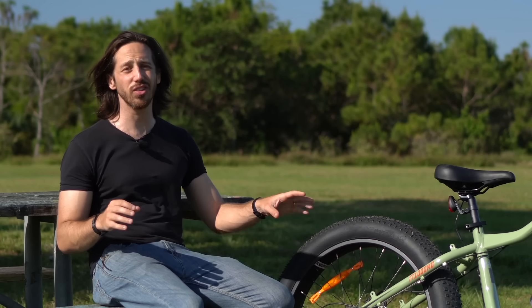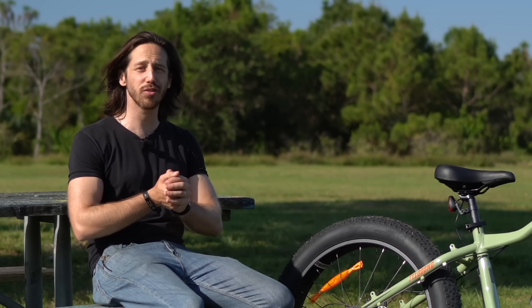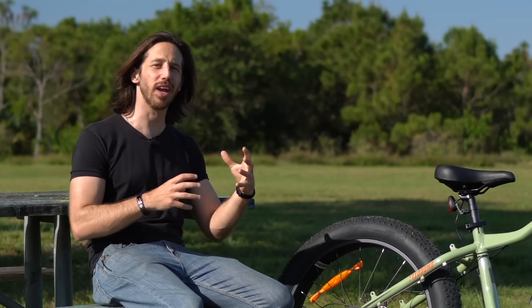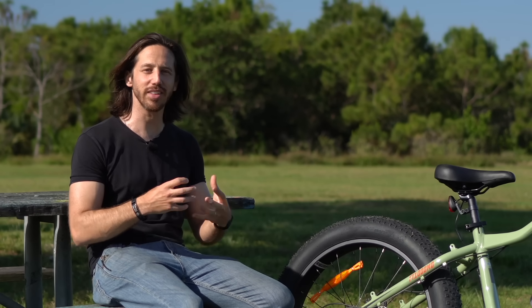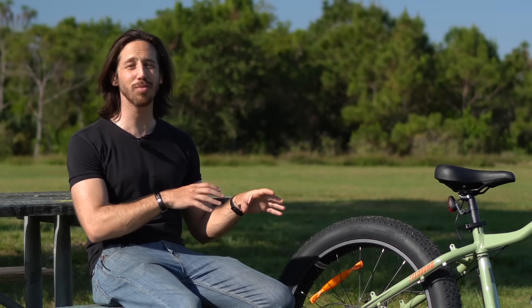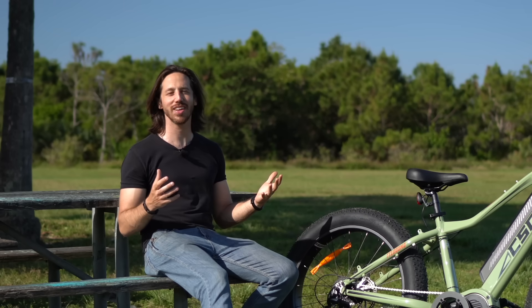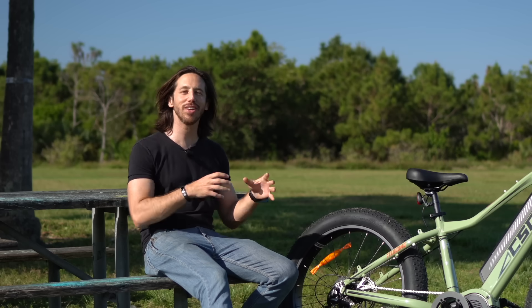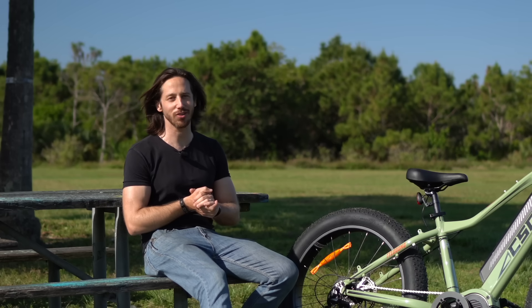The best advice I can give you is to just listen to your motor. You're going to hear the difference between when it's spinning fast and happy versus when it's spinning slower and grumbling, or you're grinding gears or hearing popping noises. Anything that doesn't sound good is not good. So listen to your motor and it'll tell you when it's happy. That's all I've got for you today — I hope you're ready to head out on your mid-drive e-bike and do some better shifting and make sure that drivetrain lasts as long as possible.